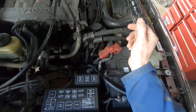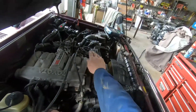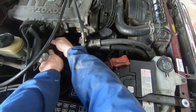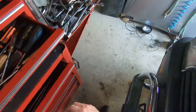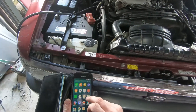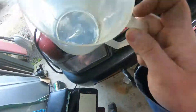Now we're going to check the fuel flow. I've located the return line — it comes out of the fuel pressure regulator, runs along through this steel tube, and pops out over here. This works for all return-type vehicles, and if you're using returnless, it's off the bottom of the regulator. I slip the hose on, grab the timer, flick on the stopwatch, and I need a measured container — I just happen to have a jug here.